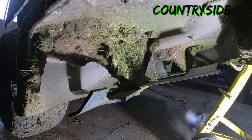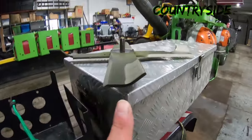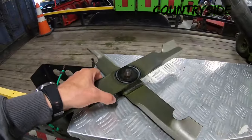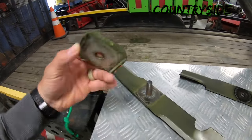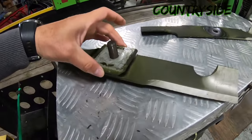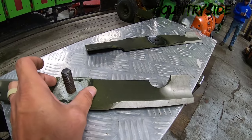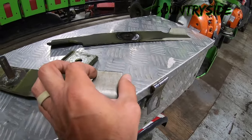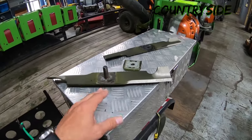So let's take these off and I'll show you how I have them on here. So here's my X blade setup. Like I said, I have a low to medium lift, long tail, regular tail blade on top. Take that one off. Here is the bracket for running X blades. It has wings that come down on that side and wings that go up on that side. So the wings that go down, when you put it on, go down over top of the edge of the blade, and then the wing comes up right there so that it keeps the top blade centered right in there. And on the bottom, I have a short tail high lift blade. This is my setup preference for running X blades.